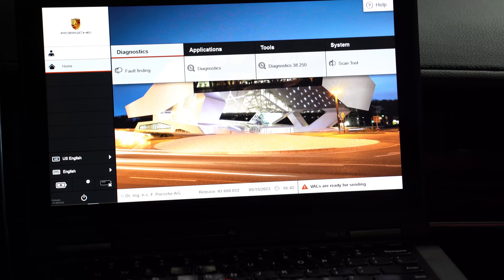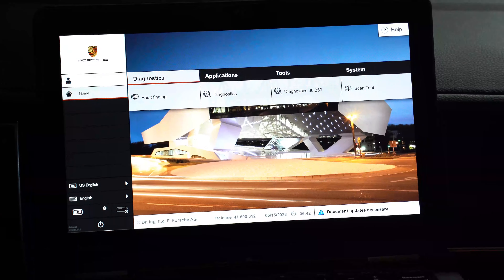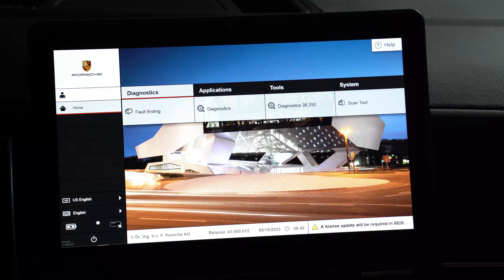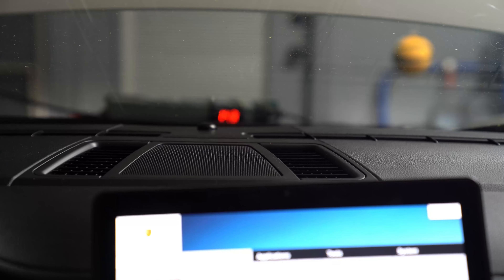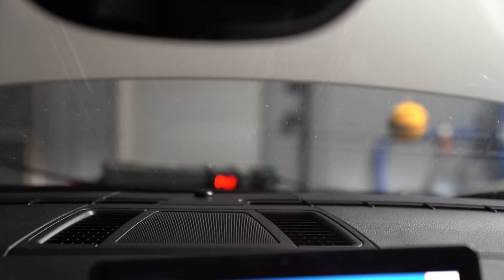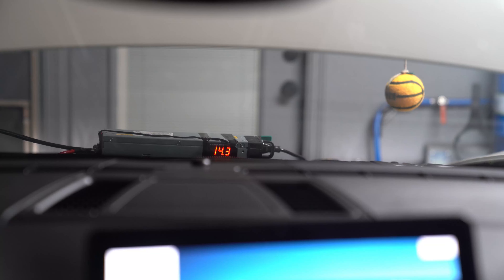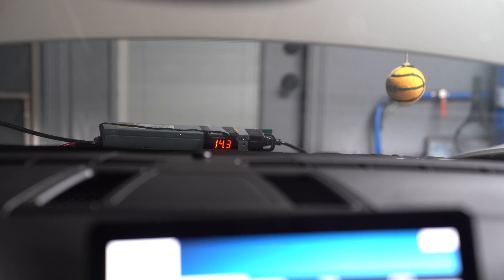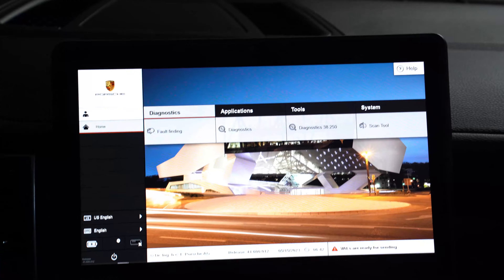I had a little technical error — came out and started shooting this video and may have lost some footage, so I'm starting again. Very first thing: here's my power supply unit. That's why I had the voltage indicator on the outside, so I can sit inside the cab and look at it. Right now it's at 14.3, which is perfect for programming with the PIWIS.